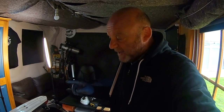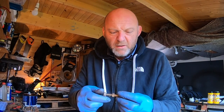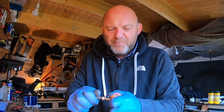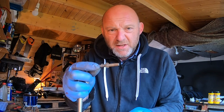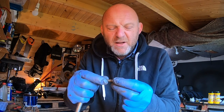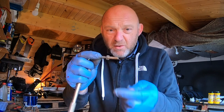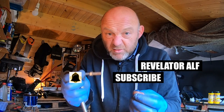I'm going to look at the length of the chain because I think it might be too long — I think what they've basically done is put a chain on without measuring it correctly. I may come back to this after I've ridden it and take a link out, but that's for another video. Before I put the wheel on I'm going to sort the chain tensioners — they slot into the swing arm and you tighten the bolt. What I don't like is there's no locking nut, so I'm going to put another nut on, give it some copper grease, and stick it in.